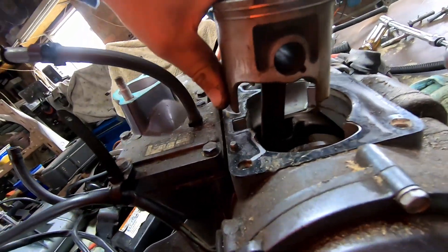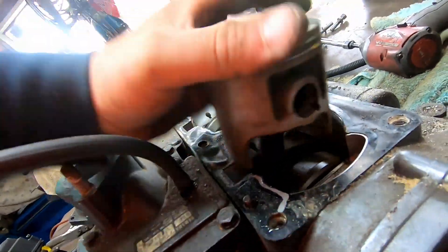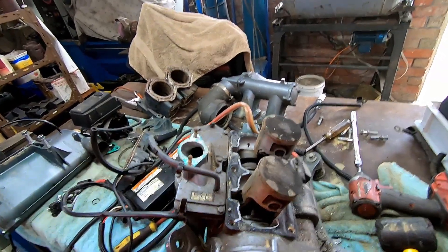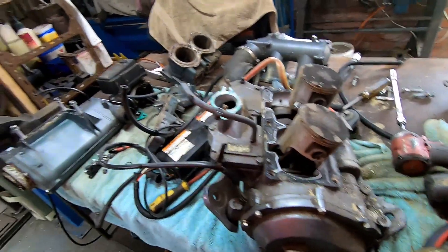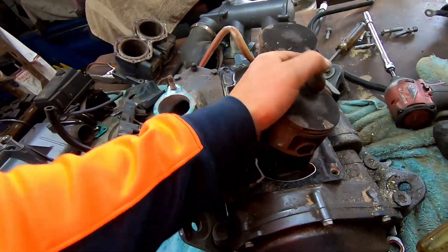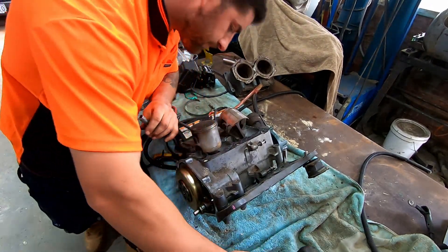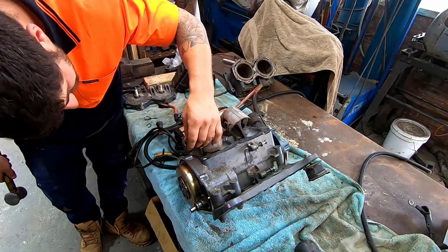The piston's gudgeon is all seized up — you can't move it. That's me pushing as hard as I can. I used to ride it like that. I took this out a handful of times and just used to do the old crowbar start to get it going, then the starter motor would make it run. I'd go out for hours just as it is now. The only thing that was ever done to it — dad did the carb before it — and that gudgeon is absolutely seized up.